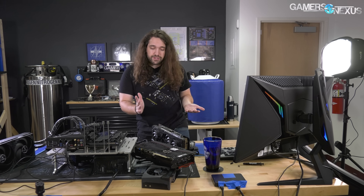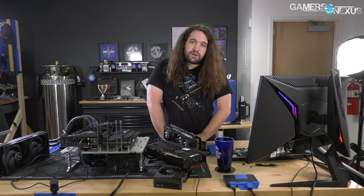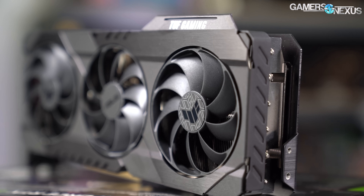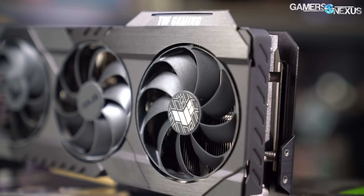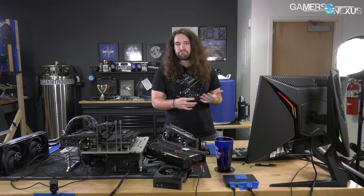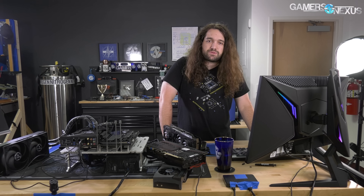What that really means is that unfortunately there wasn't a lot of overclocking headroom tonight. But with liquid nitrogen, vBIOS mods with higher power targets, and potentially hard mods, Joe and I expect we can push these a lot further. For stock cooler overclocking, from what we've seen so far, you shouldn't be expecting huge gains — which is unfortunate, because with some previous cards like 1080 Tis, it wasn't hard to get more than 10% performance increase with an overclock, or even more with the better cards.